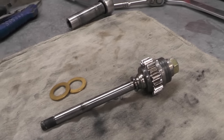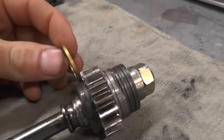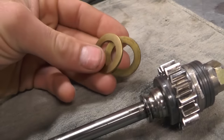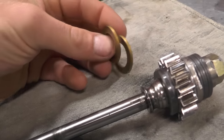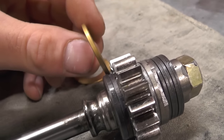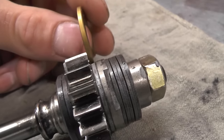Basically there are two little washers that go on either side of this little gear here, and after a while they can wear out, break apart, and go through the engine. BRP has actually made improvements with these washers over the years — the gold ones I'm showing here are good for about 100 hours.